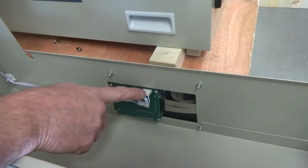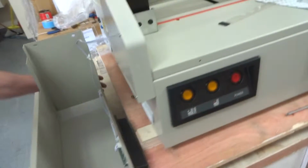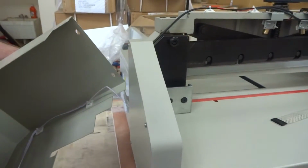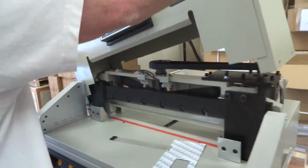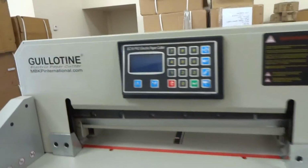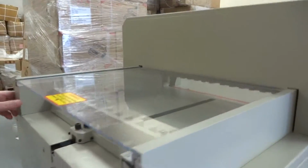Okay, just make sure this is plugged in good here, pushed all the way in, and we're going to be putting it back on. Lift it back up again, making sure you keep slack in this data wire here. If you get it tight, you could pull it, so keep this edge close there. Then just rotate it up and around. This top, just come down on it, get it back into position, and from there you're just going to put your shield back, this shield on both sides, put those back in place, and then you put your screws back in place.